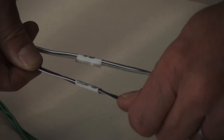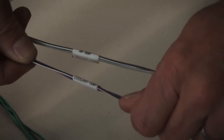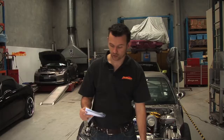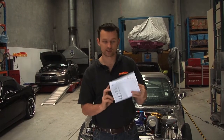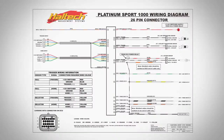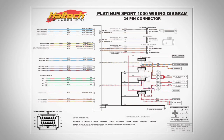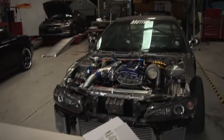For example, the air temperature sensor is just simply two wires, and the coolant temperature sensor is two wires. Just about every circuit in the harness is only two or three wires — it just looks complex because there are a lot of them. In the box that your ECU came with you'll find the how-to quick start guide, and within the quick start guide in the very center there's a wiring diagram, so that you can have a copy of that with you on the vehicle as you actually wire it up.